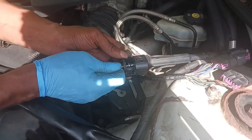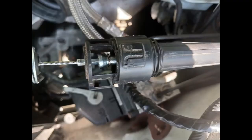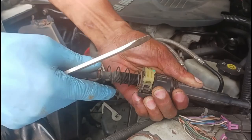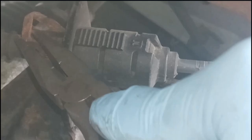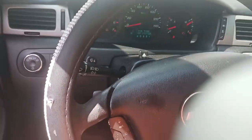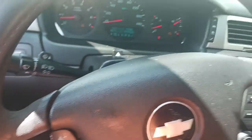This is the new one. I'm going to slide it back right in this hole. Once you slide it back in you've got to go all the way in and then reinsert your clip. Once the clip is reinserted, put it to the right adjustment, lock it back to the transmission, and connect your U-clip back in place.